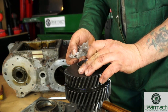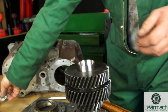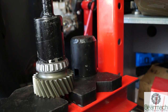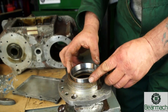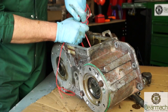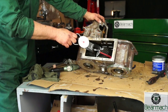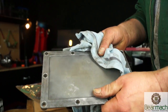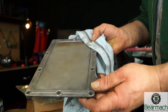In the following videos, we are going to be replacing the bearings on the intermediate gear because they are worn out. We are also going to replace the input shaft and fit a set of new bearings to it. We will show you exactly where the shims are for the input bearing, and also a couple of tricks and tips so that you can get the gearing and the shafts in properly. The bearings are preloaded on this transfer box so we need a way of checking it - we'll show you that. We will also show you what could possibly be the reason for leaky sumps. So stay tuned.